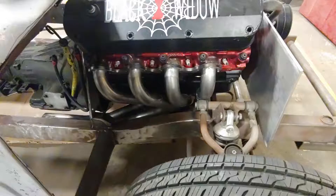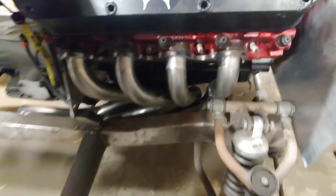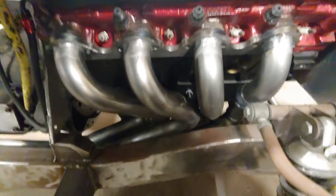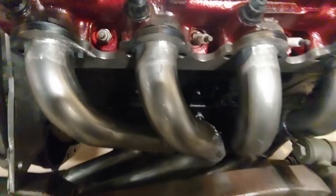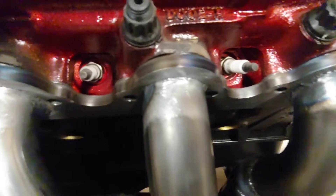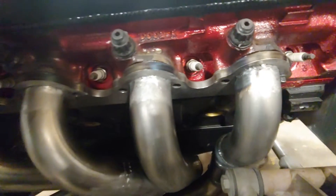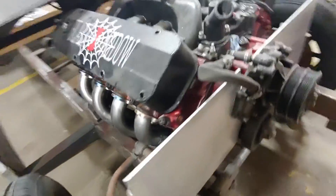See how they fit. The headers are bolted on, drop in from the top, fit pretty good. Plenty of clearance for the control arms on both sides. I did the welding on the flange on the inside, so there's plenty of room on the outside for the bolt. Plus it gives a nice clean look from the top — even if it is a Road Warrior style car, still wants some cool detail in there.